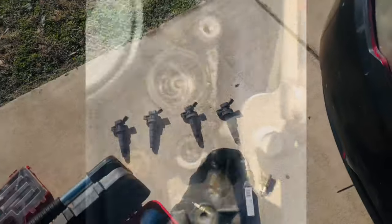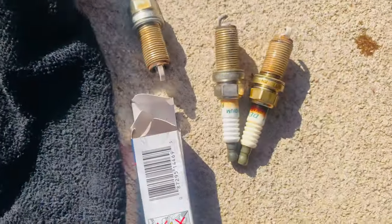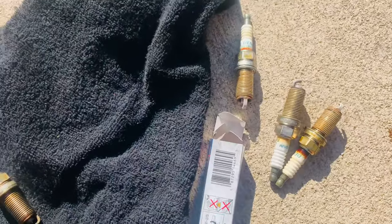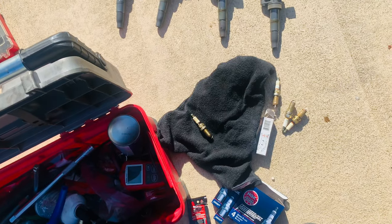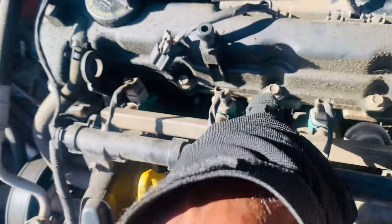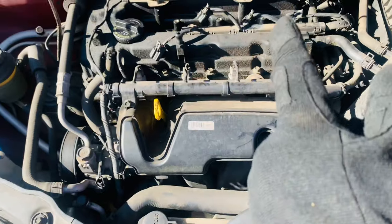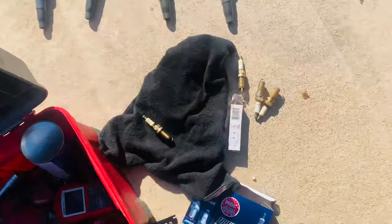All four spark plugs are out. I realized that cylinders three and four, going towards the right of the engine, had oil on both of them. The seal that goes around the engine is called a valve cover gasket. Once you replace that and put new spark plugs in, you won't have the leakage on the spark plugs anymore. I did it to my Toyota, and Jasmine's car is going to need it too. It requires you to take out the bolts all around the valve cover — this whole part comes off, and the gasket is underneath. If you don't replace your valve cover gasket and you put new spark plugs in, the oil is still going to seep through and eventually foul the spark plugs, causing them not to run as efficiently.